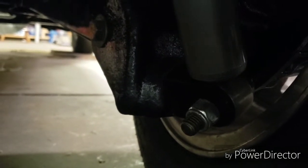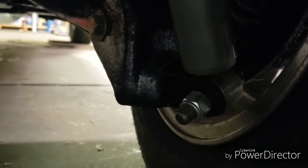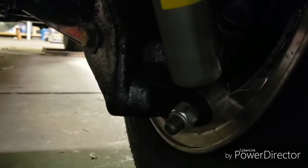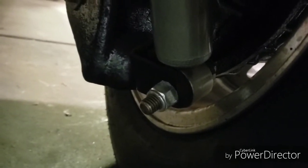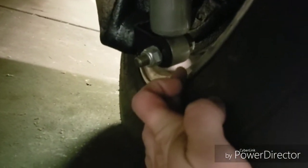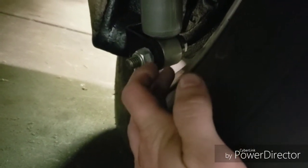The only foreseen problem I could see is that I have the no-binding lower shock bracket, which is kind of extended. It's an extended bracket that puts it a little bit lower. The thing to note is the clearance from that bracket to the wheel itself. So if you wanted to run a deeper back space you would more than likely need to run a bigger rim.